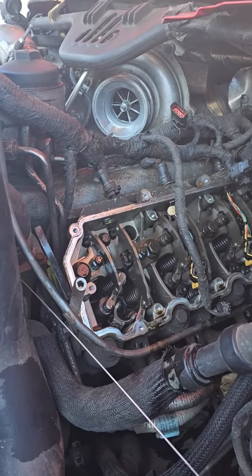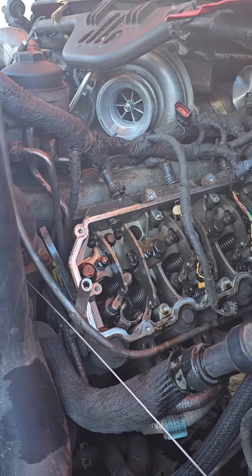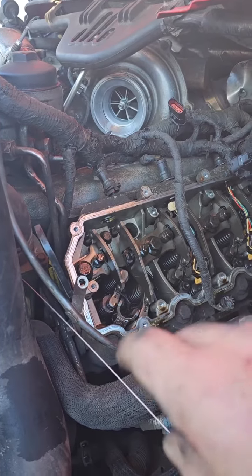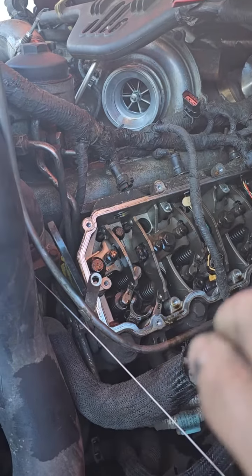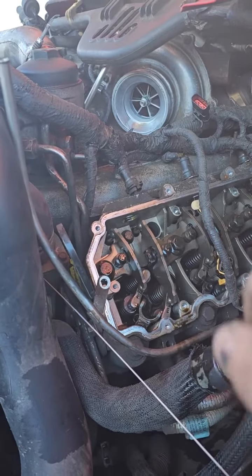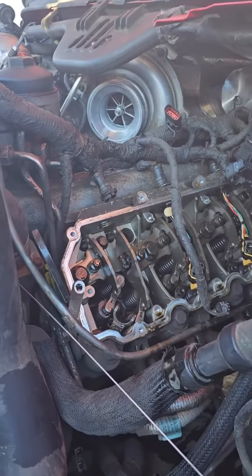You could probably use one from a coolant tester. All it is, is this little bung nut you sit and snug in there. You tighten it up until she's nice and snug on the outside wall. You hook up your air line, it pushes a quick burst of 100 psi air in there, and it pops right out.